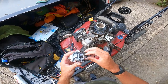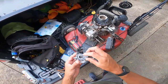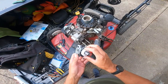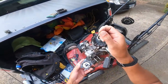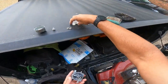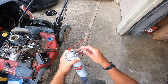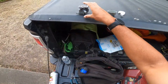Safety is very important - it's very important to wear your safety glasses and have eye wash. Now I can't see all that well with this thing on my face. I'm gonna figure out how to take this float off and take this choke out. It says Kohler - that's the idle adjustment, that's my throttle. So my jet is gonna be smack in the middle. This little pin comes all the way out - let's not lose that. The float comes off. My needle is in pretty darn good shape.